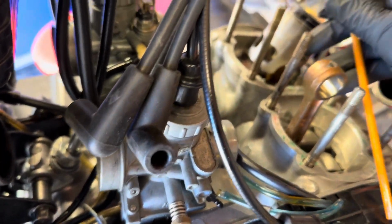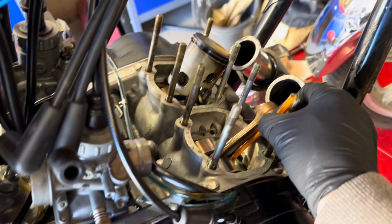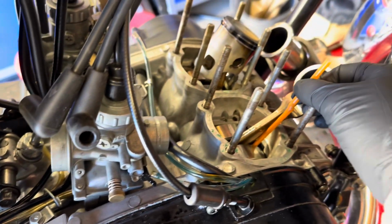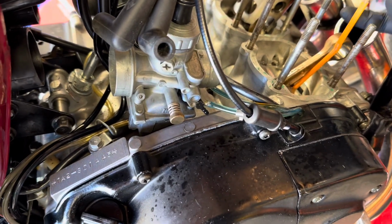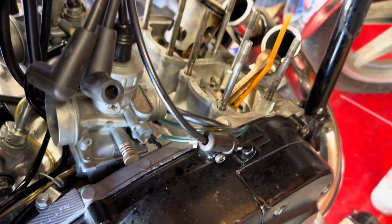And then what I did was use a drinking straw, a plastic drinking straw, put that into the bottom of the crank where it all pulls together at its lowest point, and then using an aquavac, sucked all of the debris out and the liquid through the straw. I'll try and show you, bear with.